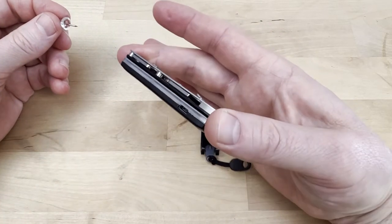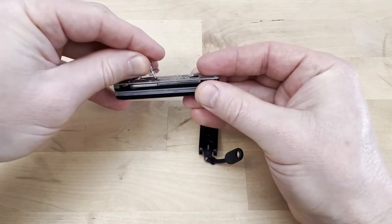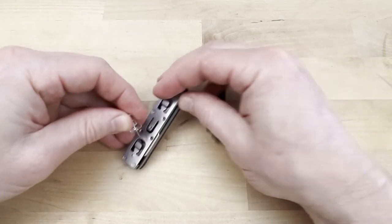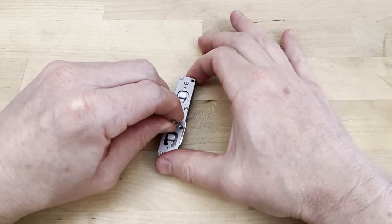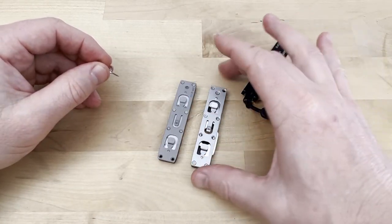To remove this stack module, I'm going to do this at a slight angle, pushing down on the edge of that arm on the pocket flare. Same orientation — I have it away from me on the table, push down on that lower arm, then push the module forward and it pops off.